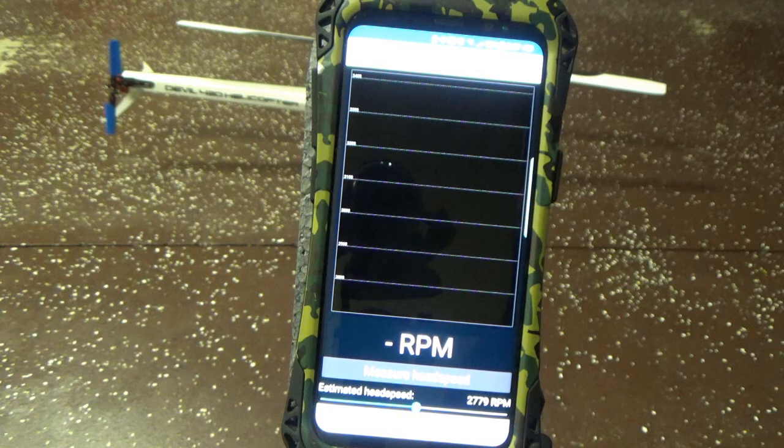In front of me is the 420 Fast Devil helicopter. I changed out the ESC here a little over a month ago to a Hobbywing. Right now in the controller it is set up for 70, 75, and 80 flatline in all three modes. I wanted to get a better idea of what type of head speed that is instead of playing it by ear.